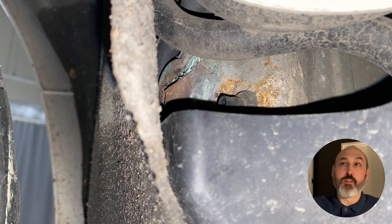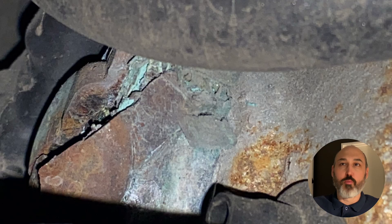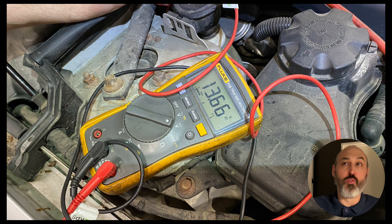The main problem — such an easy thing to find — is a split open main cable cap. Why has it done that? In winter time, water which was in the trunk (because they never bothered fixing a leak that was letting water in) expanded and cracked it. So this is leaking from the inside out. As you can see in the close-up, it's absolutely terrible — it needs a new main cable. The cap is busted and will just turn to powder when unbolted. That's where we have a voltage drop even unloaded.